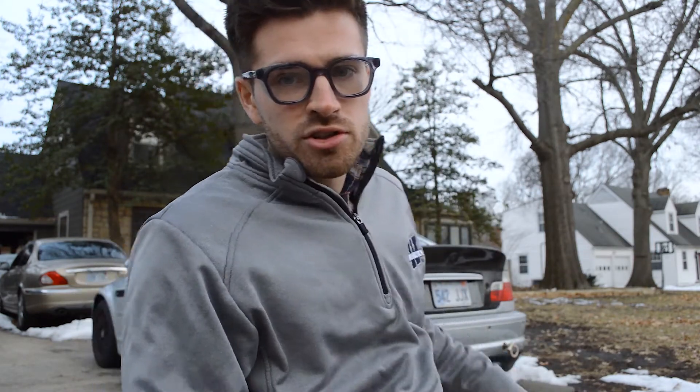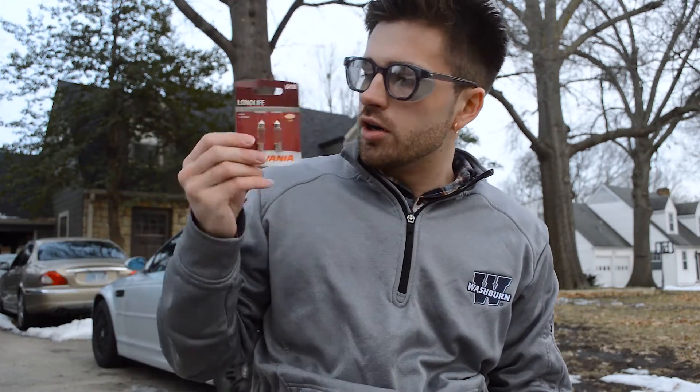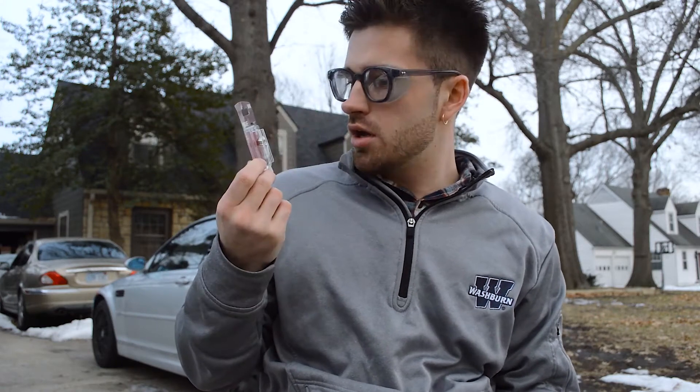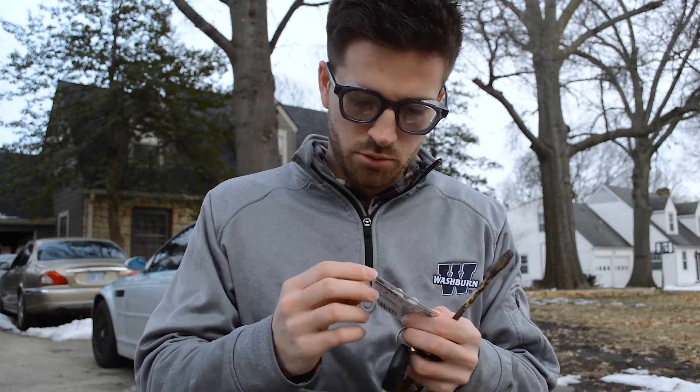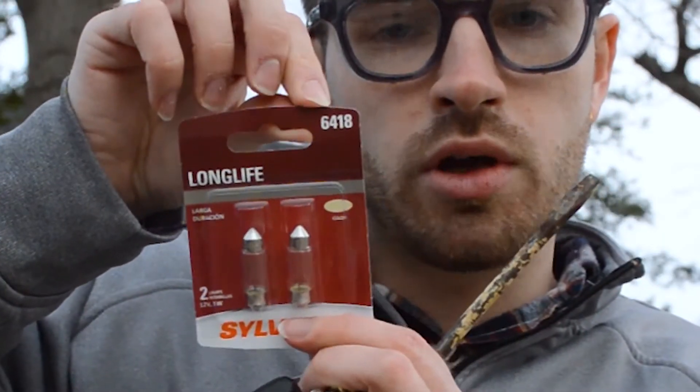The other night I got pulled over because my license plate lights were out — the little illuminators that illuminate your license plate — and the police kind of need to see that to know who's driving the car. So that's what we're going to do today. I'm going to show you guys how to replace the lights. All you need are these type of bulbs, which you can get at any auto parts store. The number on them is 6418, and you just need a little flathead screwdriver.